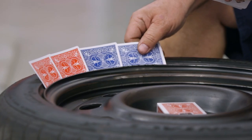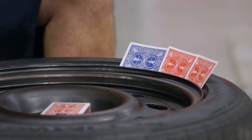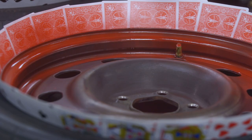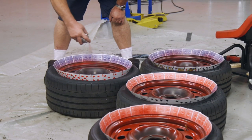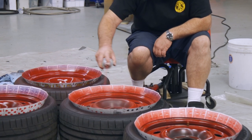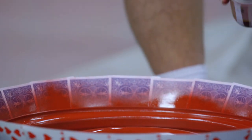When your friends or your wife or girlfriend come over and see cards in the shop — that's not a card game. You use cards when you're painting wheels. You use them to protect the tire from getting overspray on it when you're changing the color. The color we came up with is gloss colonial red. We want to give this thing an old school look, so we're going to keep these 17-inch wheels, paint them red, put trim rings on them, and that should finish off the look nicely.